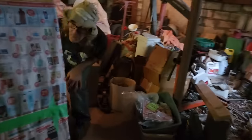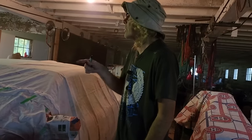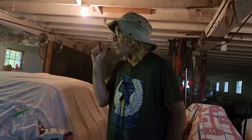No fish eyes over here. Okay, well, there's something contaminated this side then. Or it's the same. No, it's just dry. Although I have an idea. If I put it on heavy like I did there, it would have been fish eyes. You think? It's maybe that first can of paint is contaminated due to not washing out the gun.